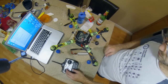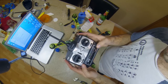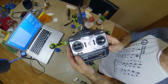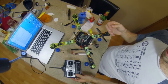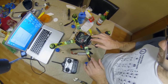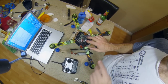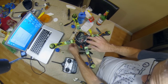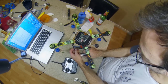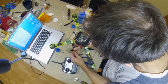Turn on your radio, put the throttle all the way up like so, then turn on the radio. Here's the tricky part — if you have four hands it's easier. Hold button number one and button number four, then plug in your battery. You've got to kind of do it with one hand, so sometimes getting it prepped and ready to plug in helps.